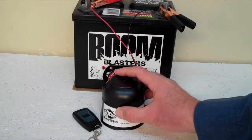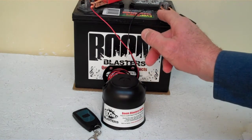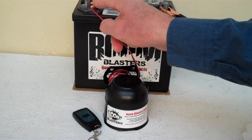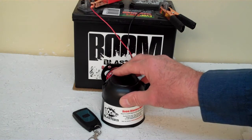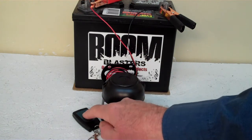Quick and easy installation: your black wire coming from your horn will go to a ground somewhere — it could be your battery, just anywhere you've got a good ground source. Then your red wire coming from your horn will go to a 12 volt power source — it could be your battery, a fuse, just anywhere you've got a good 12 volt power source. So this is one of our best sellers, guys — this is our Jeepers Creepers wireless car horn.